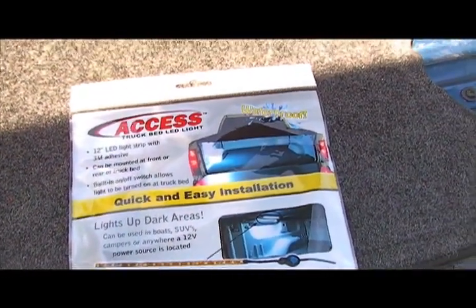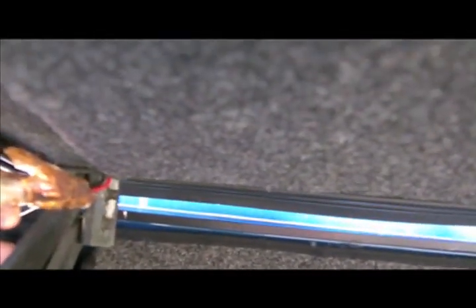First I want to show you the installation site. The reason I need this light strip is because at night, with a tonneau cover on the bed of my truck, I can see absolutely nothing. I don't have a flashlight because the cargo lamp that would illuminate the inside of the truck bed is blocked by the tonneau cover. This particular tonneau cover — a SnugTop fiberglass hard top — is actually pre-wired. You can see back here in the corner there's a wiring harness, and my guess is that harness runs up under this panel and comes out up here.